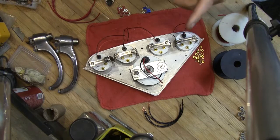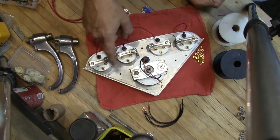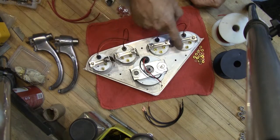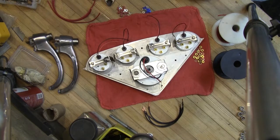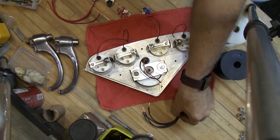The other thing is all the grounds can be run together. Each of these instruments also has a ground terminal — the G terminal on the back is the ground — so all the grounds can be wired together. It's a 12-volt system, so it's very simple. It can be grounded anywhere. If you have a good wire under the dash that you know is a good ground, you can do that. If you need to ground to the firewall, you could run a wire all the way back to the battery, but probably you've got a good ground somewhere else. Just find a common ground and you'll be good to go.